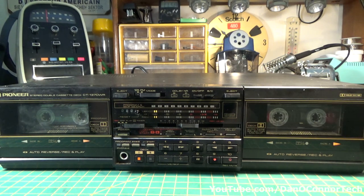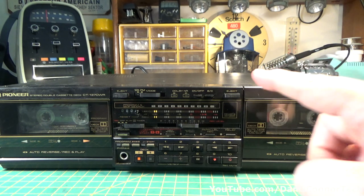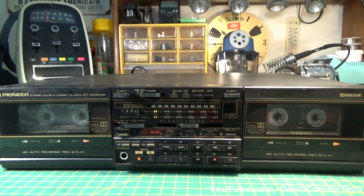All right, let's try and copy my YouTube music tape. I'm not going to use the Dolby noise reduction because it will only use whatever Dolby is already on the original tape, which is nothing. Setting this to Dolby and trying to record Dolby on this tape when copying does not work. It records whatever Dolby encoding is on the original. So we've got a blank tape.